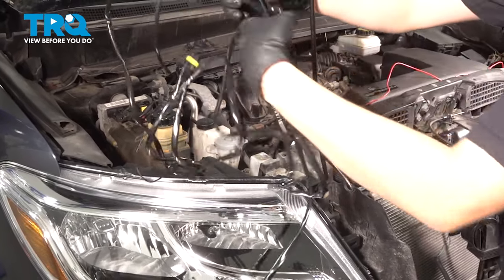Now let's test them out. It all works. With the ignition in the on position, the switch should light up, and it does. When you press it, not only will the fog lights turn on, but the light at the bottom will turn on also indicating that the fog lights are on. I can look right now out the windshield — yep, they are on, both of them are working. Press it once again and they shut off. Also, because we wired it to an accessory power source, I can leave them on, shut off the vehicle, and they just shut off — meaning there is no way to forget your fog lights on because they will not have power with the ignition off. So make sure you don't wire it to a source of continuous power, because that means you can easily forget them on and drain your battery. Now adjust them so they don't aim too high or too low, and take it for a road test.